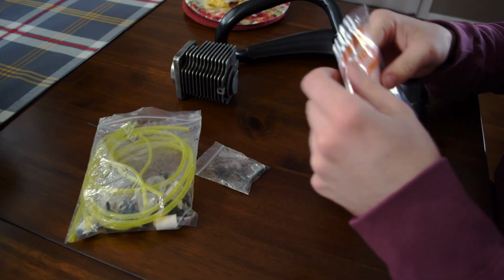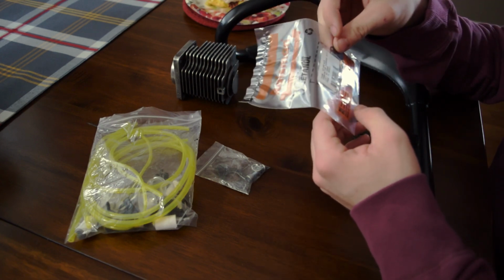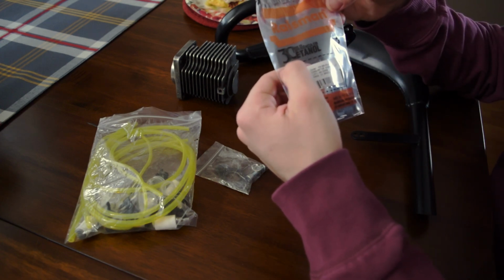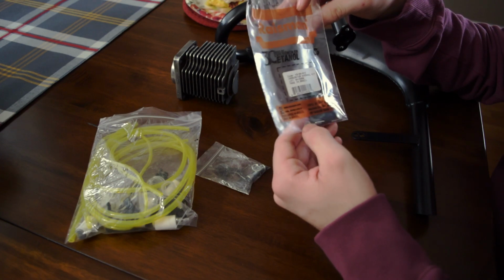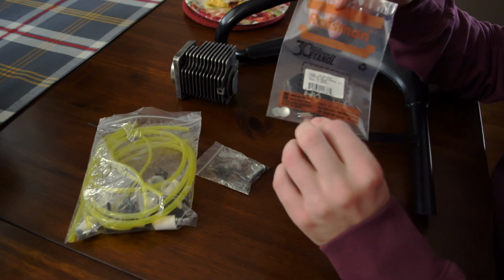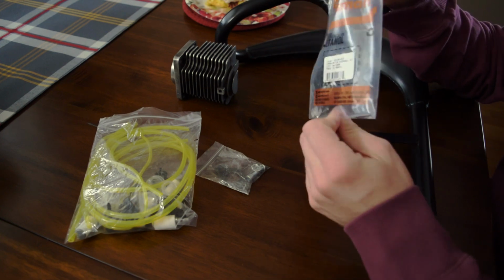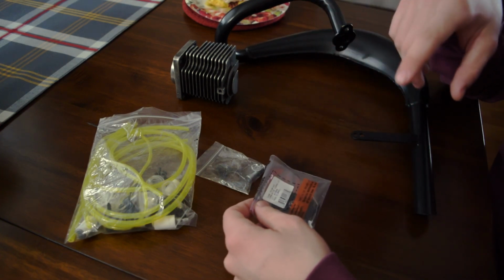Alright, the second thing is, of course, Carb Rebuild. You're going to need this if you're going to be working on any saws at all, because the little metering diaphragm in them goes bad because of the ethanol really quickly. However, this one is ethanol approved, whatever that means, so hopefully it won't go bad. But it comes with your metering diaphragm, comes with a strainer, Welch plug, all that good stuff. This was like $11 I think, and so we're definitely gonna get a couple more of these ones for the boy saws. Also, I'll try to put the links to all these in the description. This one is for a Zama 2C because we're all going to be running them carbs.